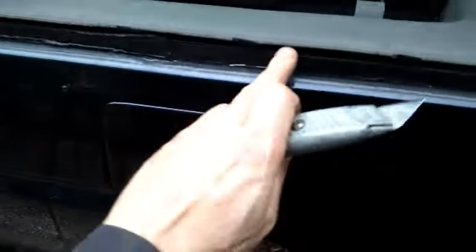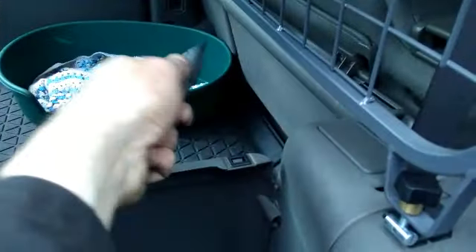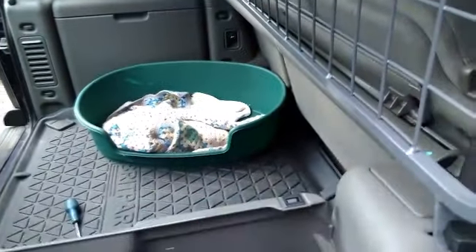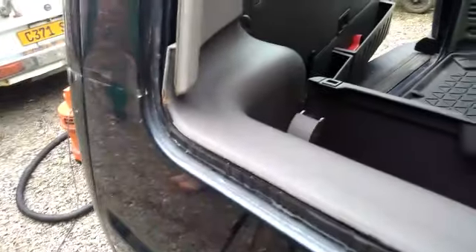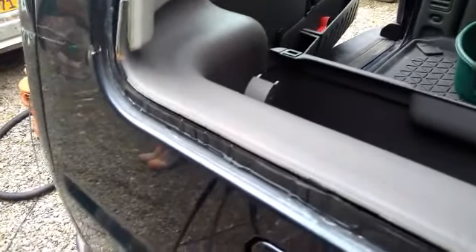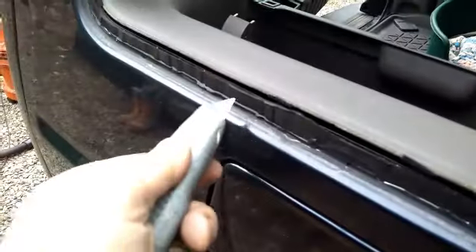To ease cleaning this old bonding sealer, I've taken the two screws out and disconnected this side of the dog guard and slid the load cover tray off. That enables me to move this back just enough so that when I come to stick the window on, this isn't pushing against it. This old seal stays there because that is the best surface for bonding the new piece of glass - and the same on the glass as well, because it's a used bit of glass that'll have bond on it. This stuff apparently likes to stick to itself.